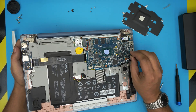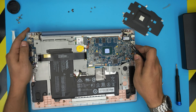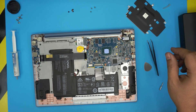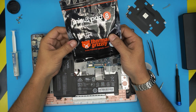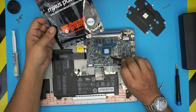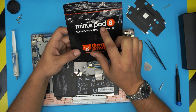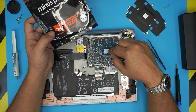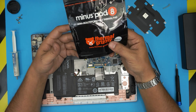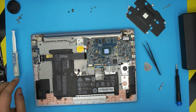Since there's a thermal pad and not thermal paste, there's not much point in removing it — you won't get significantly better results. But if you want a better thermal pad, you can go with the Thermal Grizzly brand — their Minus Pad is really good. This one is 0.5mm; get a 0.4 or 0.5mm thermal pad, cut it to the correct size to cover the CPU die, and you're fine.